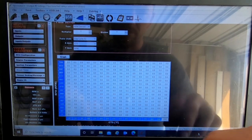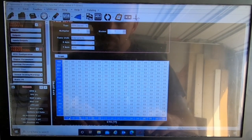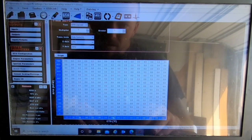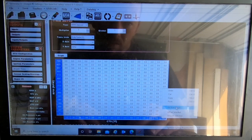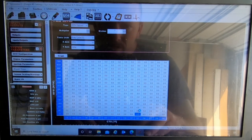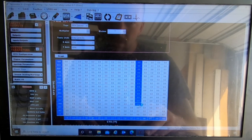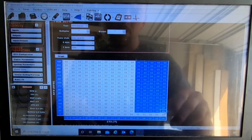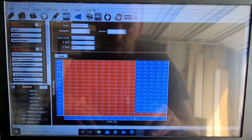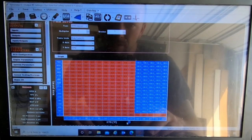We'll just say 250. It's never gonna see that temp, hopefully. But there we go. So we want the fans to kick on. Let's say above 400 RPMs, and above that temperature. So 100% duty cycle because we're using a relay. And then they'll turn off once they hit 167. That's a little unrealistic. Let's go 175. And that's when they should shut off.